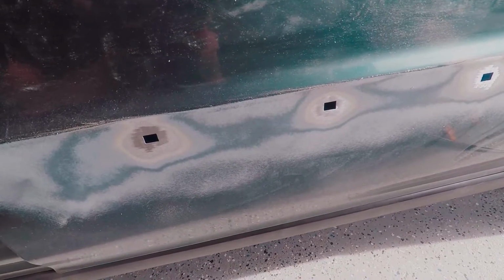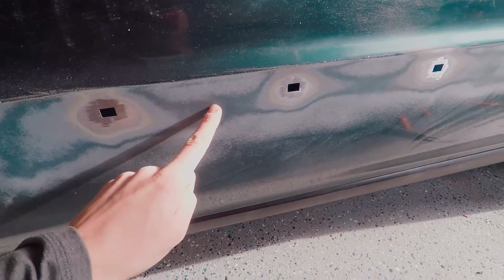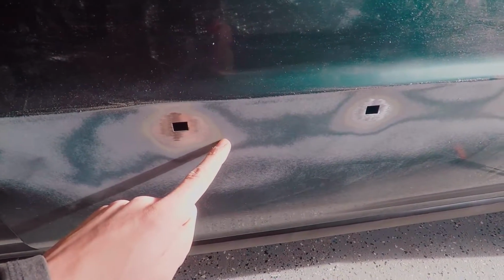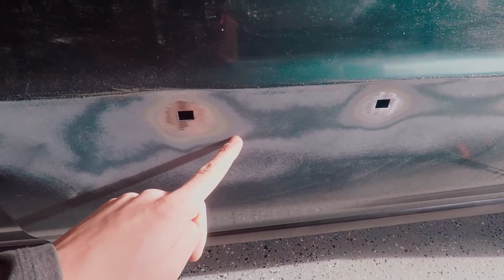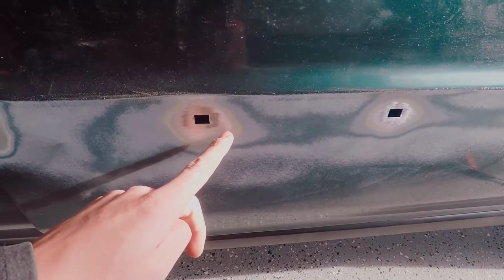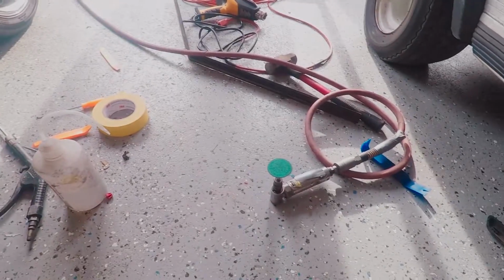Alright, so I'm all sanded up on the outside. It's kind of cool. You can see this is where the clear coat is scuffed, and this is where you're getting into the base coat, and this is where you're getting through the base coat, I guess, and into what might be primer, and then there's another primer. This is probably a sealer from the factory, and then there's my 80 grit DA scratches, and then the 36 grit from this guy right here.